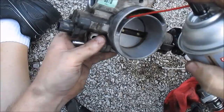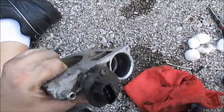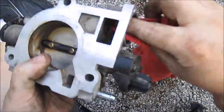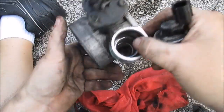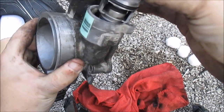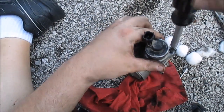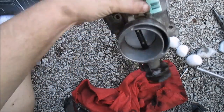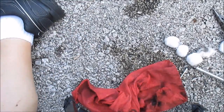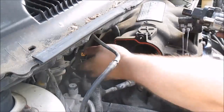It can make the idle speed go up or down depending on how much that valve opens or closes. So I'm going to scrub this out a little bit. Anyway, that's a lot better. I really think I probably should replace this just because of how gummed up it was. Okay, that screw sucked it down quite a bit — I think it's about ready to go back on. I cleaned it off about the best I could.